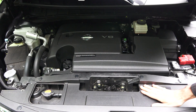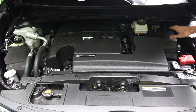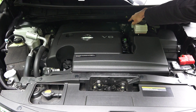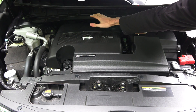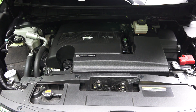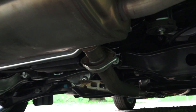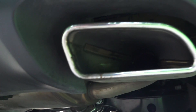It produces 260 horsepower at 6,000 rpm and 240 pound-feet of torque at 4,400 rpm. Following the intake air path, it comes in up front, passes through a resonator into the air filter, back to the electronically controlled throttle body, and into the plastic intake manifold. Exhaust exits through one of two exhaust manifolds, collects into a single pipe, and exits through one of two tailpipes at the rear.